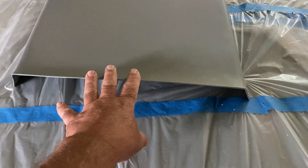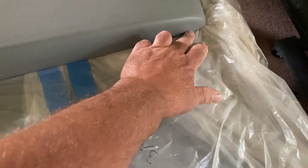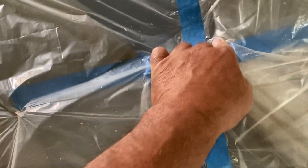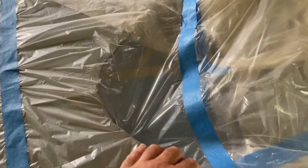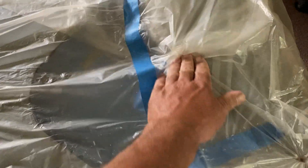We have the super stock scoop, which has been cut to match the actual radius crown of the hood. So when you bolt this thing down it has a perfect shape to match the hood — it doesn't belly out or anything. We did a quarter-round on the outside edge. This became a bolt-on scoop instead of a mold-on — you remove it, and there's a hole that's kind of arrowhead-shaped, because that's the shape of the bracing inside. We followed the bracing and had to put a little half-circle on the back end, making metal to continue the bracing.